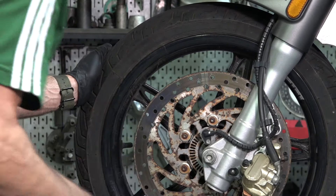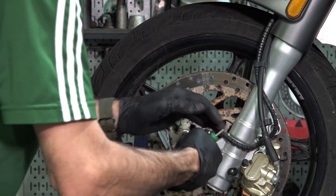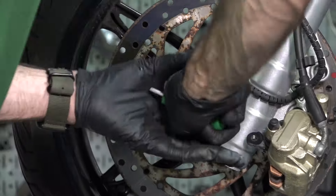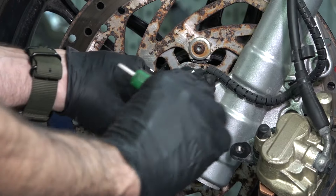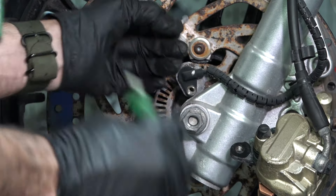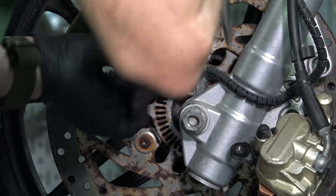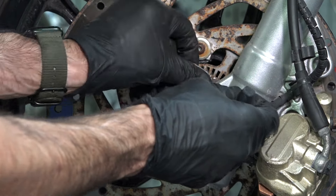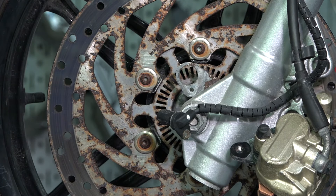Before we remove the tire, it's pretty easy to damage this speed sensor. I have a little bracket that holds the speed sensor — I think it was a four millimeter. There's usually a lot of Loctite on this screw. It is possible to remove the wheel with it in place, but it's just nice to get it out of here so you don't damage it — it's a lot of work to change it. And sometimes they're a little stuck, so give it a little tap. In some cases they might have a shim behind. So go ahead and set the speed sensor aside.